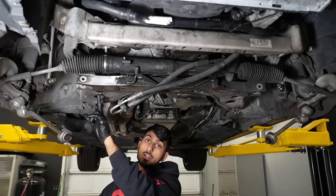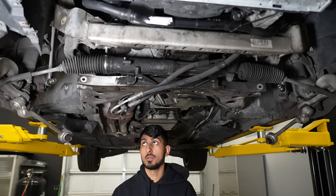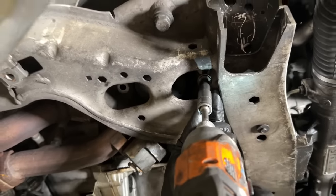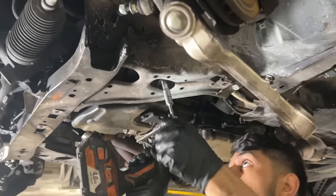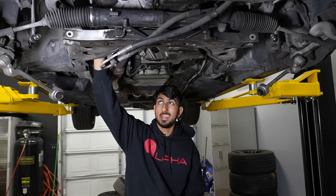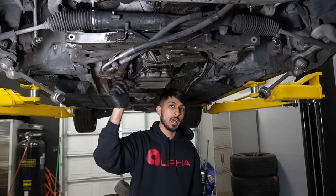Let's remove the two external Torx E12 bolts that attach each engine mount to the subframe itself. Note that these are one-time use bolts, so you are going to replace those. Once the engine mount nuts are removed from the top as well, you should be able to wiggle the engine mounts around with your hand. The passenger side usually has a little more tension than the driver side because the engine tilts that way.